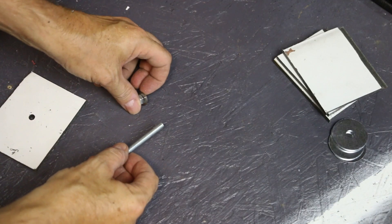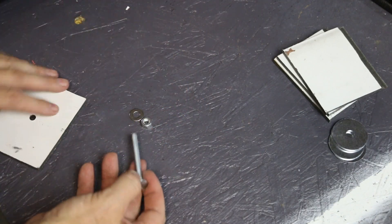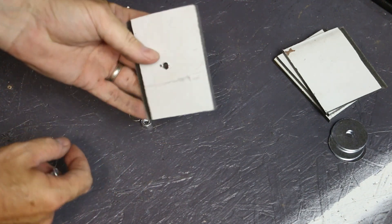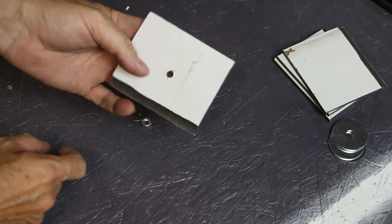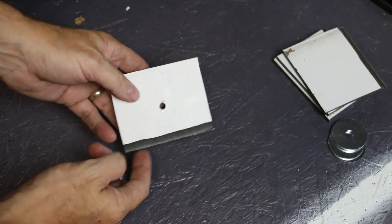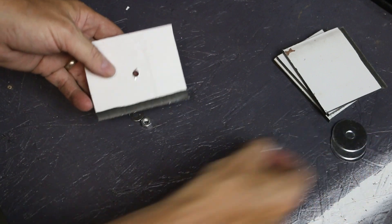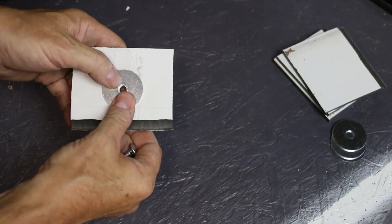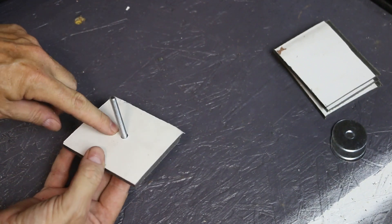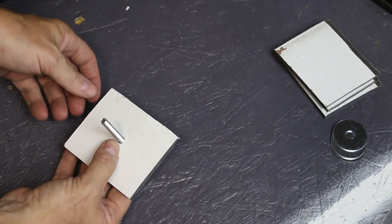To attach the roof rack I'm going to use these carriage bolts. Since I'm going just through the ACM, I'm going to make myself some big flat washers with some scraps in order to double up the strength. I'm also going to use a fender washer on the bottom and I'll get some adhesive in here as well to make sure we don't have a leaky roof.